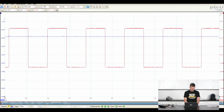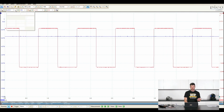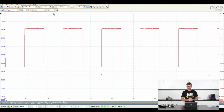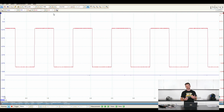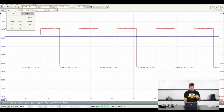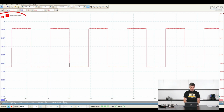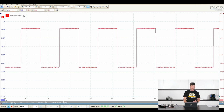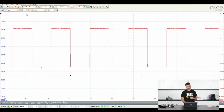So if we come back to setting play here and our sample is running, on the PicoScope we should be able to start at least by setting our voltage per division here to auto. And again, that's just going to span our channels so that the signals we're looking at are at least visible. The other thing I will mention, we already looked at it, is if we've set something too low, we're not going to really see anything, but we do have this little warning that pops up, telling us that our channel is over voltage. So if we see something like that, that is a good indication that that's our problem. And again, just going to auto should fix that.